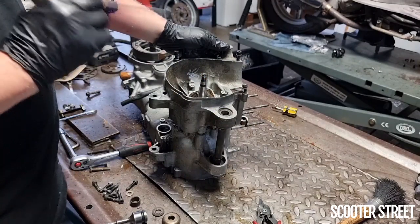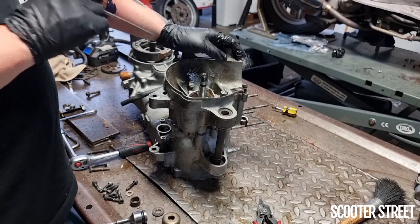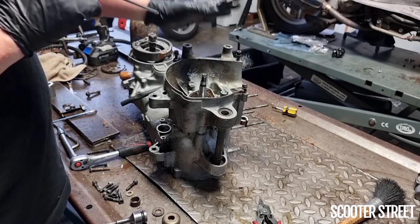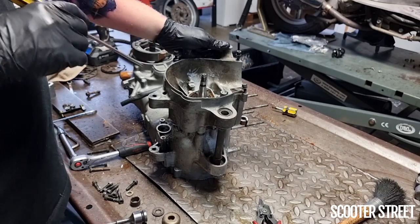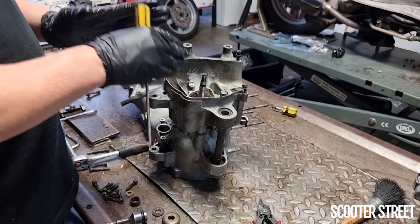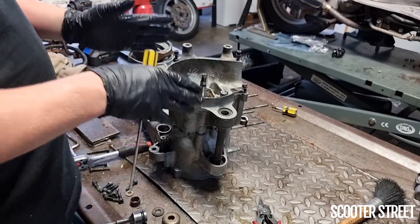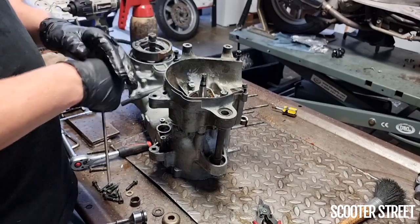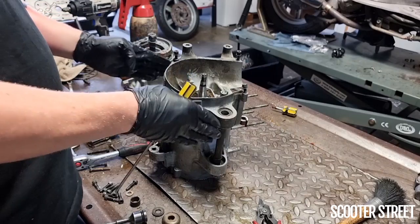So one thing I will mention is, if you haven't done this before, every 3 to 4 tightens, you'll notice a slight knocking, clanking sound, which is normal. This is what you want. What essentially happens is, as you tighten a couple of the nuts, tension builds up between the crank and the bearing, whichever is going to be moving over the crank, and it essentially sits down in little steps.